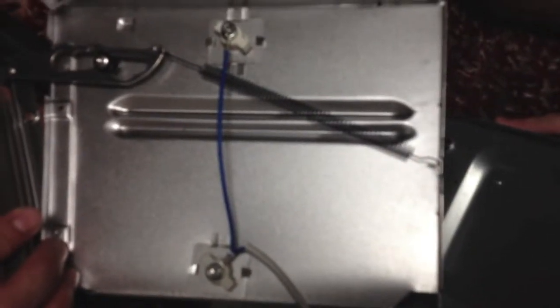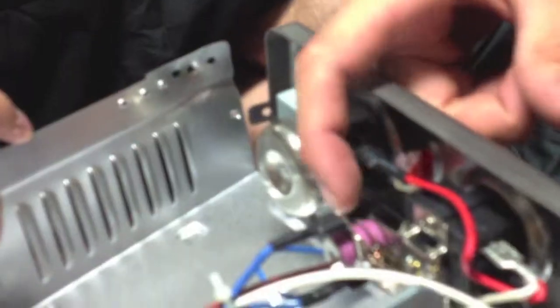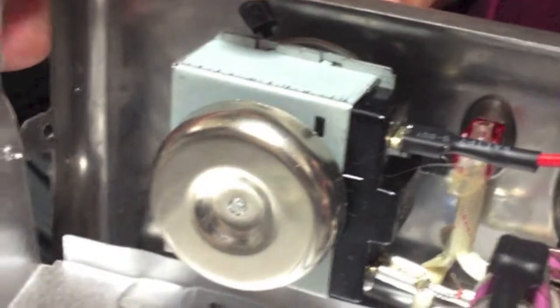The spring mechanism creates a more efficient heating process by not allowing heat to escape through the front of the toaster oven. The timing mechanism does not draw power from the outlet independently — the power has to pass through the timing device before the toaster begins heating, allowing power to be controlled by the timer and temperature knobs respectively. When the bell rings and the timer goes off, it interrupts the flow of current, effectively turning off the device.